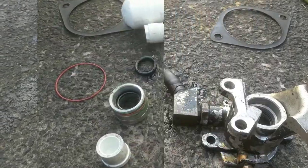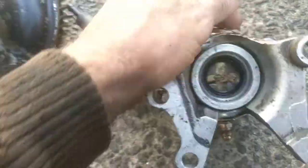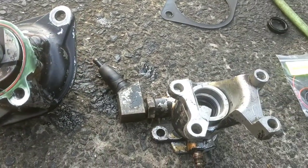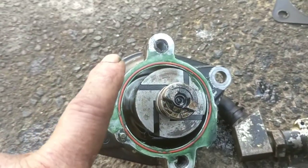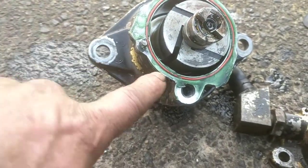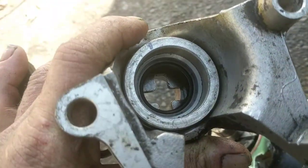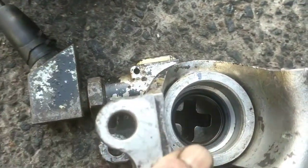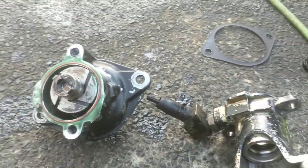With the seal driven in, the little crosshair piece just sits loose inside. Replace your o-ring and rub grease all around inside and outside — it holds the o-ring in place and helps with sealing. When putting the back cap on, stick your finger in to align the crosshair piece with the cap. The crosshair has two prongs for the vacuum pump and two for the power steering pump — that's how it drives the power steering pump. Put it back where you marked it and bolt it together.